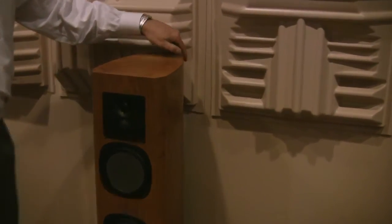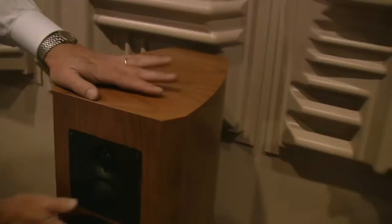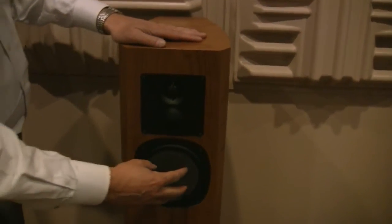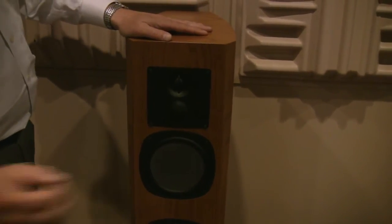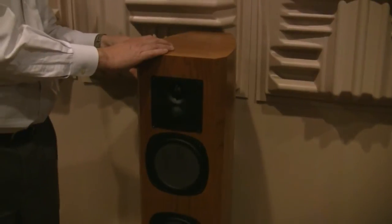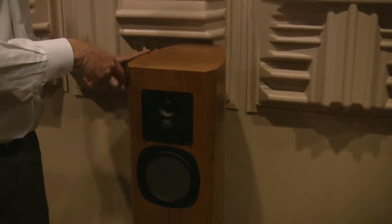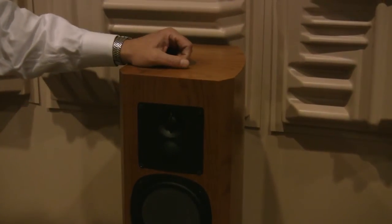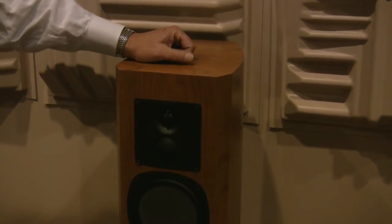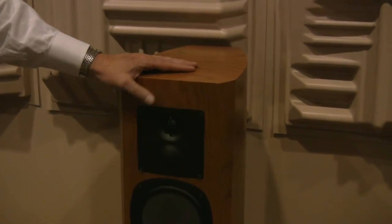One of the other unique features of the PC series is the rounded or curved sides, which makes for a very rigid cabinet. The reason you want a rigid cabinet is because when it's reproducing sound, it's producing as much sound in the direction of the room as inside the cabinet, and those internal sounds tend to vibrate the cabinet surface itself. By having this radius, plus using three-quarter inch MDF, it makes for a very non-resonant cabinet that isn't adding anything to the overall sound of the speaker.